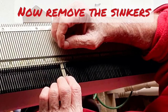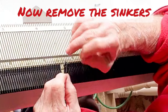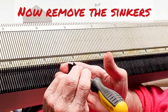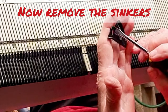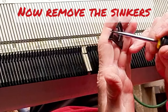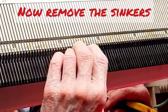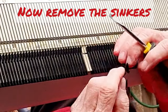Here's how it works to get this out. What you've got is this hook shape thing in the little groove — the hook. Notice that it does have a foot on that hook. There's a foot right there on that section of this sinker. So what you've got to do is get it where that foot is disengaged. That sound you hear is that little tiny hook right there popping into place.